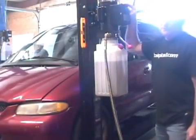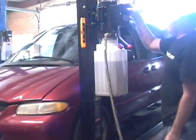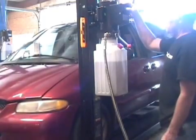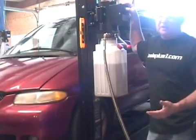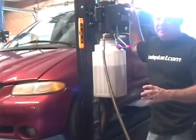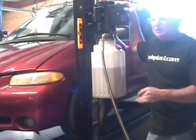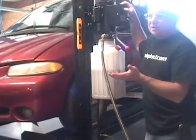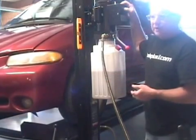On this particular lift it's 110-volt. We're going to hit the button and raise it. You should hear all of the safety locks click in — four different locks, all clicking at about the same time. Listen carefully for those. Just like on a two-post lift, you want to raise it above that catch and then lower it onto the safety latch before you start working on the vehicle.